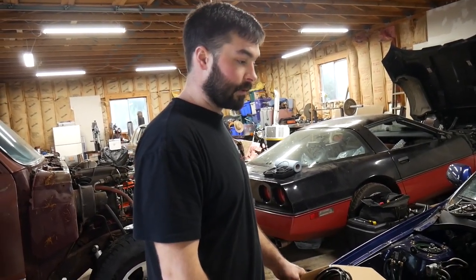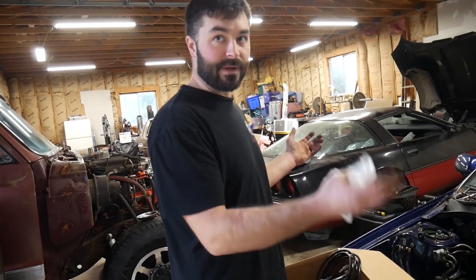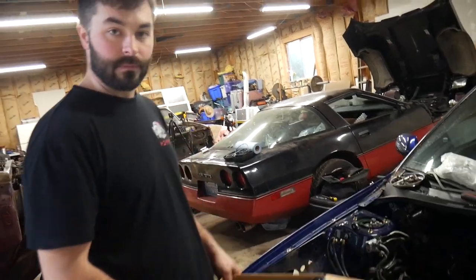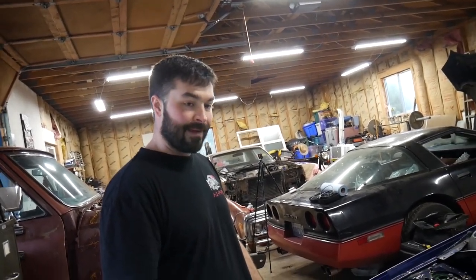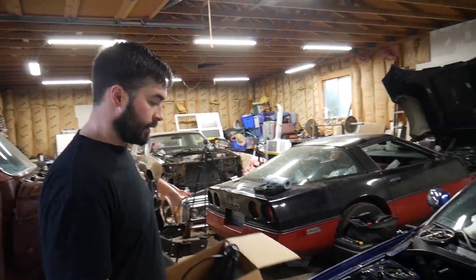A lot of people do this if you have a rally car or a show car and you're trying to clean up your engine bay. For me, I autocross it and I've got a bunch of faulty stuff because some of it's 2000, some of it's 06. Whoever did the swap didn't swap everything over from the 06 — it just doesn't link up. And the cover that was on the ABS pump was broken when I got the car, and water was getting into the electronics. So that probably fried the ABS pump to begin with. This will take care of all of that.